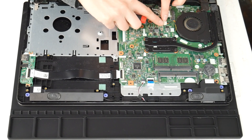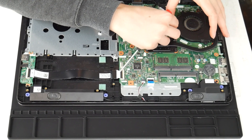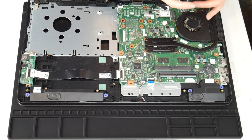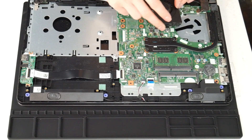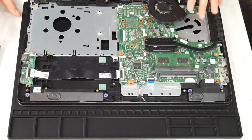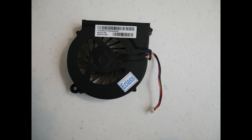Next I'm going to show you how to clean your fan. This is another big reason why people have issues with their computer overheating. I'm going to unplug it and then take the two screws and undo it. I'm going to take a high pressure air cannon — you could also use a hair blow dryer or a can of compressed air. I've included the can of compressed air and the air cannon down below. This is what your fan looks like. If you find it's still loud, you can find replacement fans on places like eBay and Amazon.